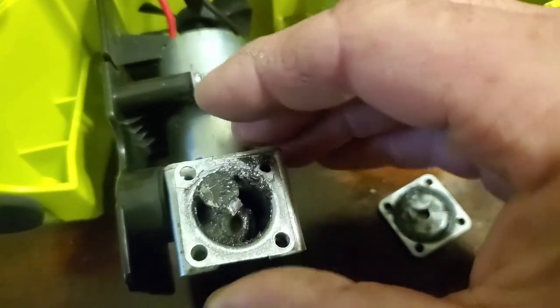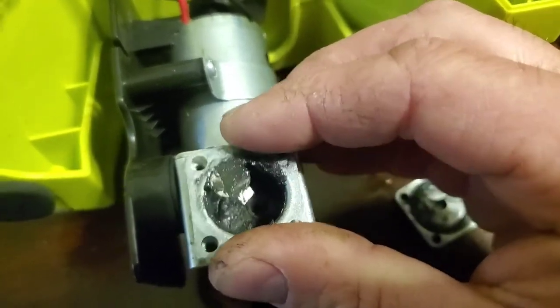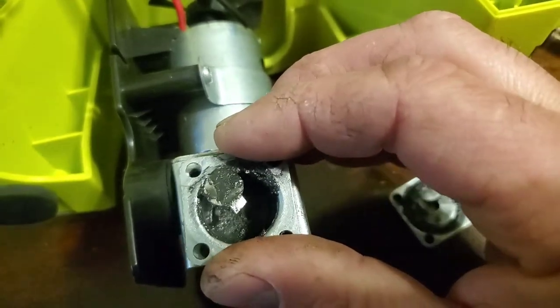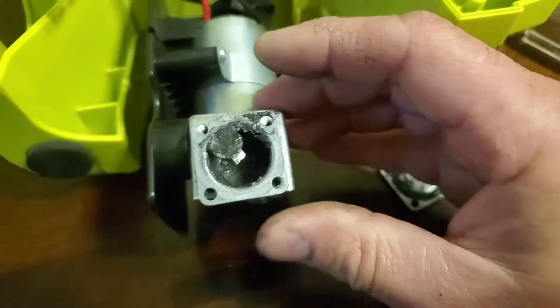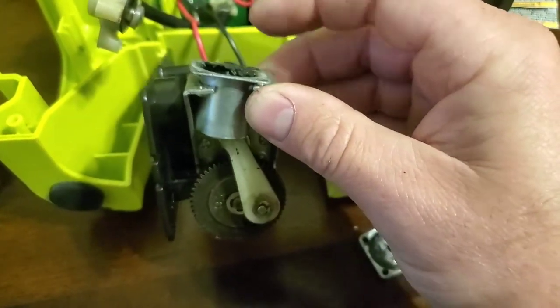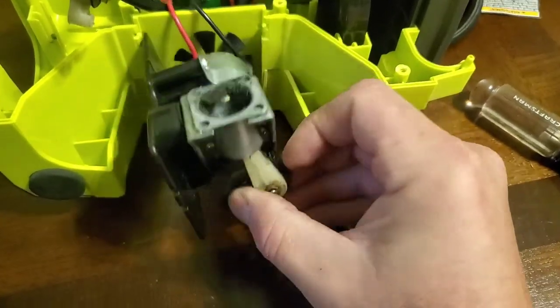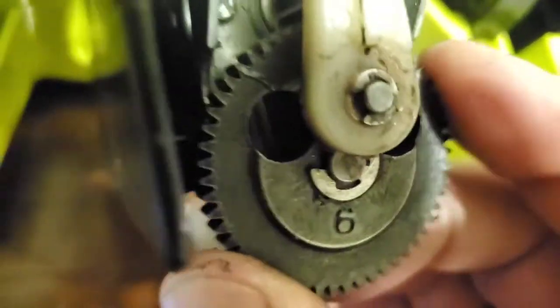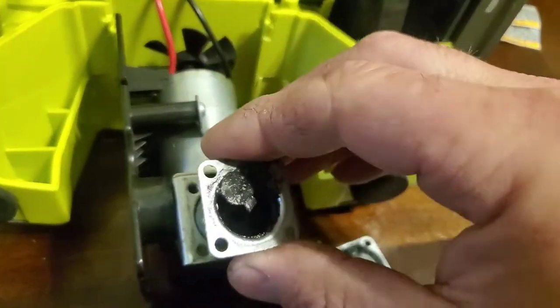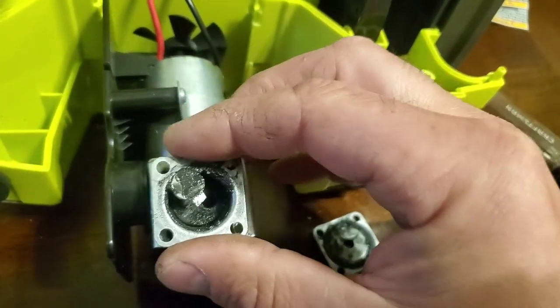What is part of the sleeve, maybe? You can see the piston down in there. It's moving up and down on it. It's not wanting to just slide out, so something's not right. I need to put it on top dead center. That's what it was. I didn't put it top dead center. You got to take the number one cylinder, and that's what it is, boys. You always put everything top dead center. And it's not coming off. That thing must have rings in it.